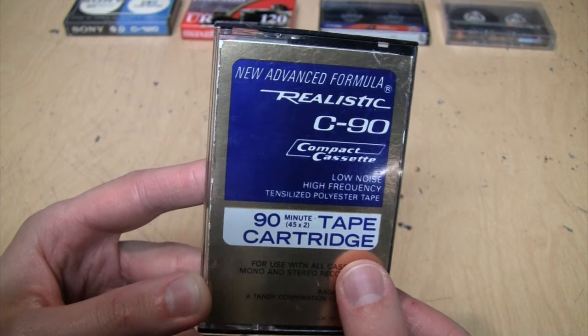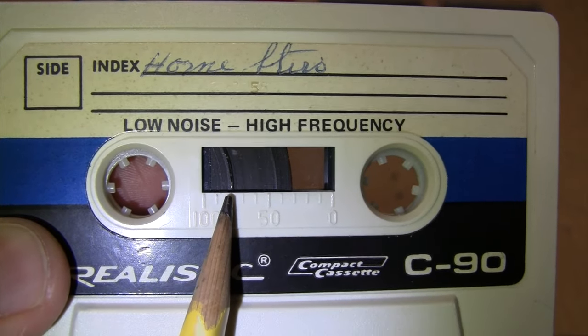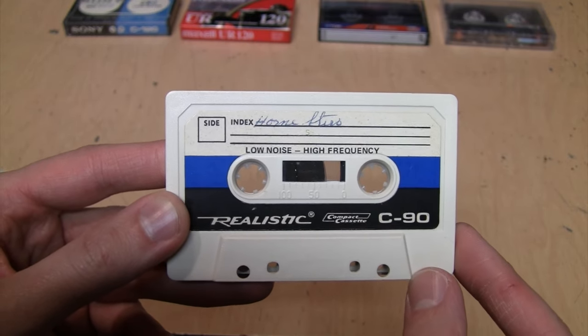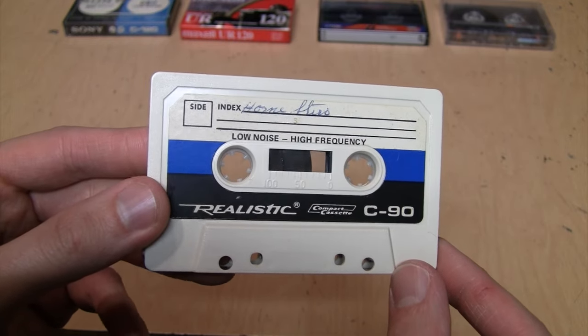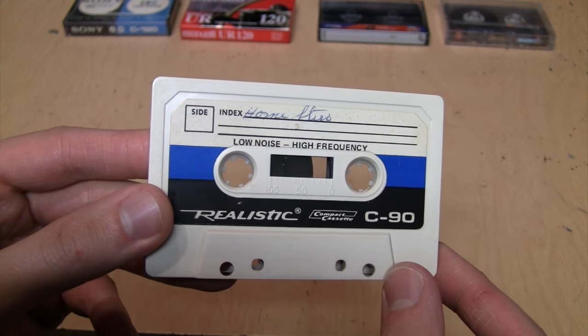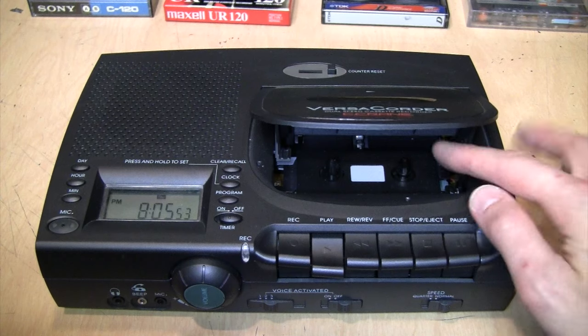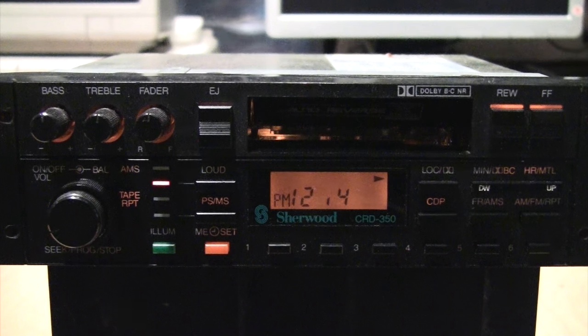Notice it's so old it calls it a tape cartridge. You can see I had to splice out a section of tape that had become badly stretched, and that damage could have been due to the crudeness of the equipment back then — most of which only had a simple tension trigger auto-stop mechanism that would not stop the tape if it became tangled in the pinch roller. But for the past 30 years or so, any halfway decent cassette mechanism has full auto-stop, and most people aren't playing cassettes in their car anymore, so they're not subject to the same extremes of temperature and humidity.